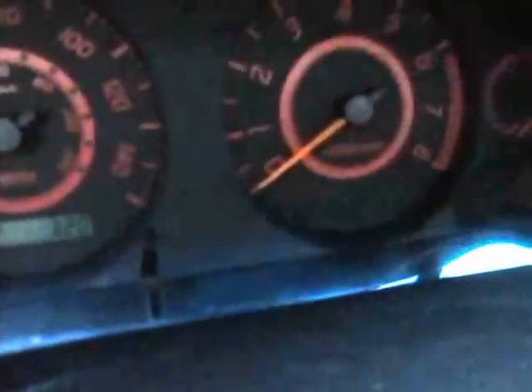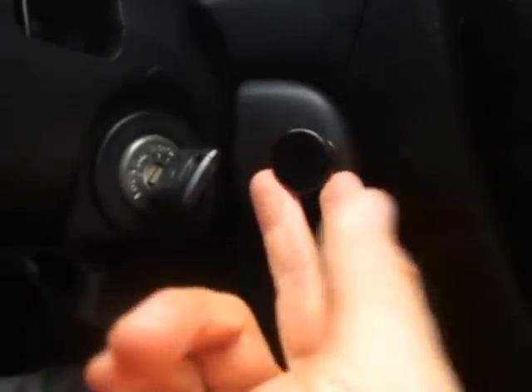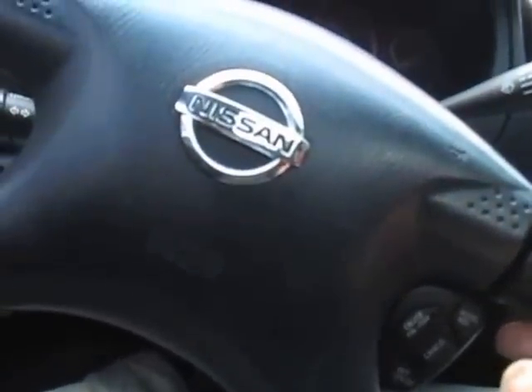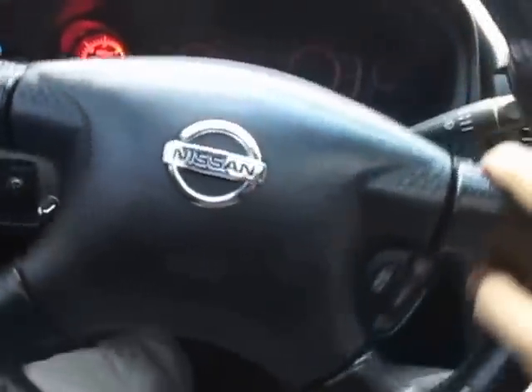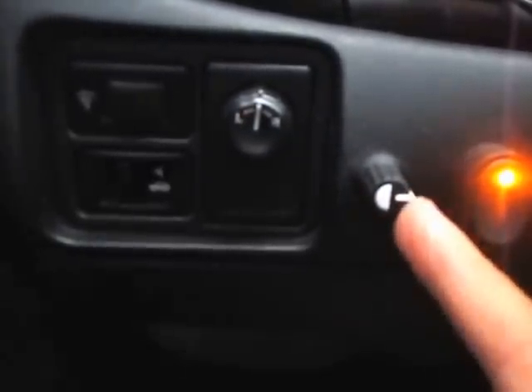Typically the vacuum stays between 20 and 25, so the alarm never activates while driving — it's just for emergencies. All other indicators are working fine. The speedometer and tachometer work fine. The temperature gauge doesn't work since there's no engine, but that's fine. This is the emergency disconnect — you pull it to stop the car in an emergency. The car has OEM electric power steering which is quiet and very powerful, with a potentiometer to adjust the assistance level.